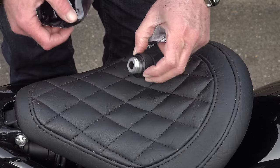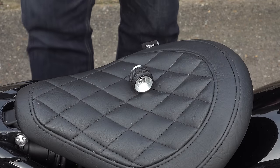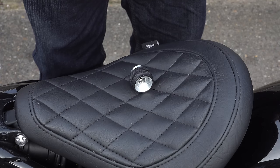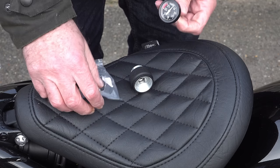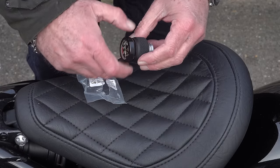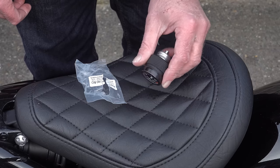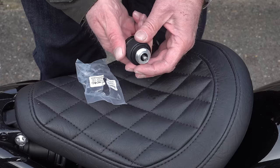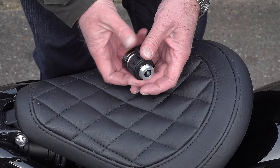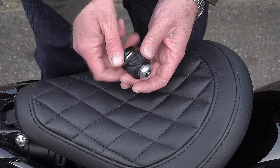The bit that makes this kit different is the oil filler cap itself. You're never going to get a device like this to seamlessly meld in with the engine — it's always going to be a compromise — but with the clearances available they've ensured it's as unobtrusive as possible when fitted to the bike. Some manufacturers use cheaper temperature gauges with a shorter probe, which can affect accuracy by quite a lot. Motone wanted the best accuracy achievable, so the mount has to sit quite high to stop the probe from getting damaged by the engine. The housing is designed with an air gap around the probe to allow even heat distribution, so accuracy is about as good as it gets.